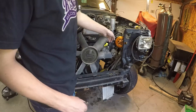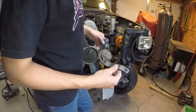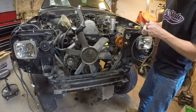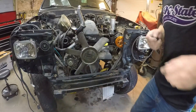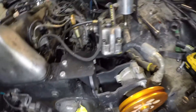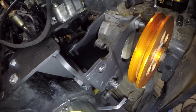The reason for that is because we're going to be installing the tensioner from your 22R. To do that I've formed a little bracket — it installs by bolting onto the engine block and to this little hole down here. There you can see how it bolts onto the engine block.